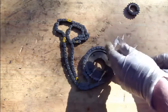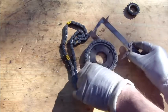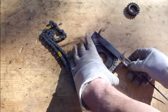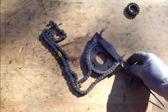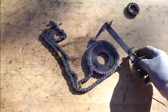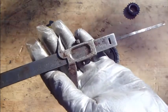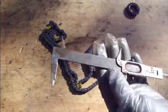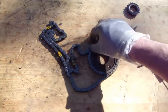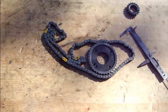Let's check what this result is. Let's check how much material I have in that wheel. Now there is this measurement — the result is 9.8 cm. The minimum was 9.7 cm, so this is just okay. This camshaft wheel passes this measurement test.